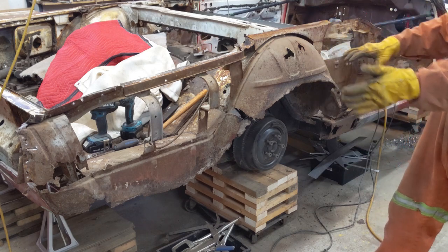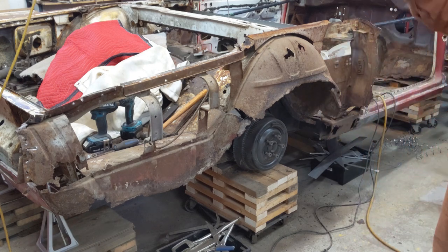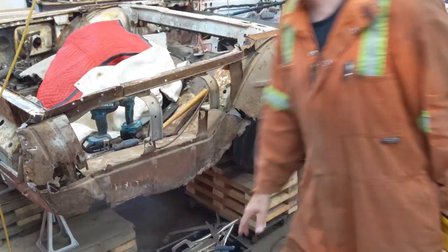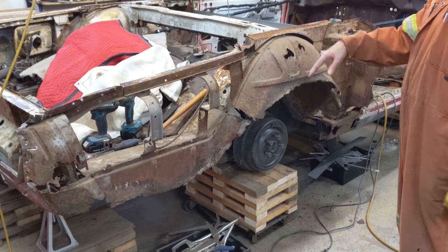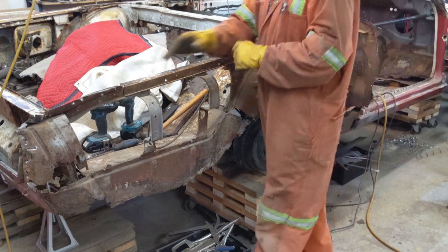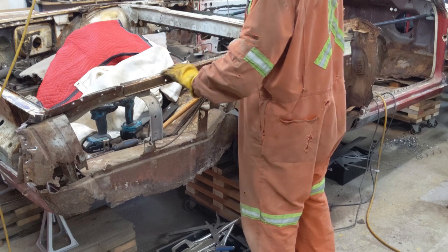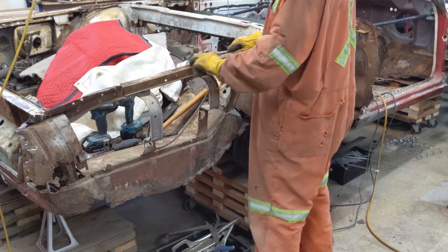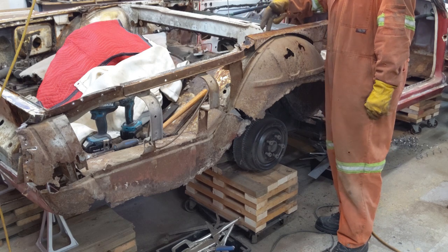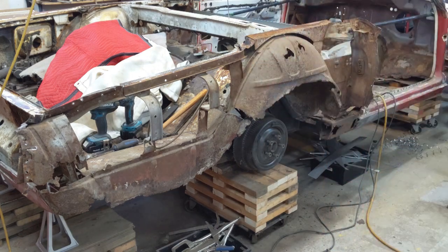Look at that glory. I'm going to get you down off the tripod and we'll have a look at the damage that's in here - there's a lot of it, but now I have room to work. I started videoing on time-lapse a long time ago because it's really just breaking spot welds all along here. Funny thing about this car - with all the rust, these trunk lift rails are in really nice shape. Well, they were in better shape before I beat them up, but I can hammer-dolly them back around. I had to cut a little bit of the lip off here because there's just nothing left there anyway - it's all rusted.